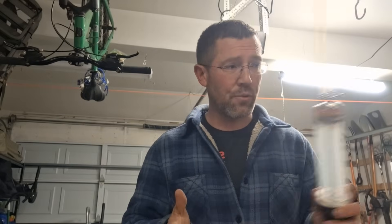Brake fluid is critical to your system — does it last forever? No. We've covered this with other fluids. But especially in a humid environment, it degrades faster. In dry climates like Colorado, New Mexico, Arizona, or Utah — if you park in a garage — I've heard of people having brake fluid for five to eight years, putting 100,000 miles on the car and never touching it. If you're concerned, just suction it out and pour in new fluid. Also check your manual — maybe your car calls for something specific.